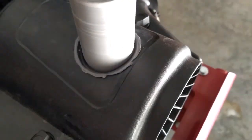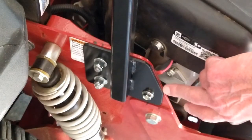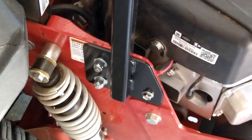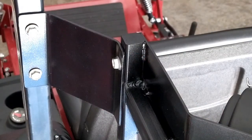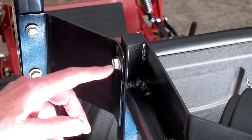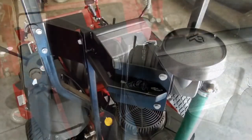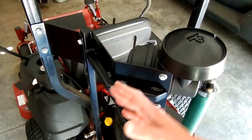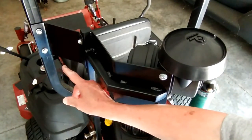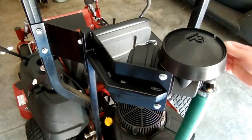I split a piece of vinyl tubing to go around that opening. I tapped an existing hole in the frame for 5/16ths, put a little thread locker on that, and I've got nylocks on these two bolts. This rollover protection bar was drilled and tapped for 5/16ths. I put some thread locker on that and did the same thing for this bolt that goes into this vertical square tube. When I put the air cleaner on here, this whole thing would vibrate like a tuning fork. So I had to put a support back to the rollover bar, and it still vibrated, and I had to add a little more stiffening. Now that doesn't vibrate at all.